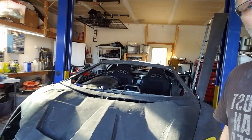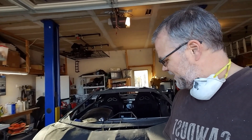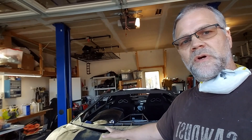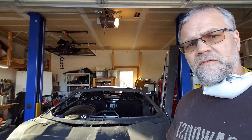Some of you have seen some of the distortions in the panels — these are a problem. We've decided to keep the carbon fiber look for a while and I don't want it to look like complete and utter crap, which it does right now frankly. So we're gonna fill those with some carbon fiber and epoxy, maybe a little matte, then smooth it off and put in a beauty layer of carbon fiber over the top. I've done that before, so it's not too big of a deal.